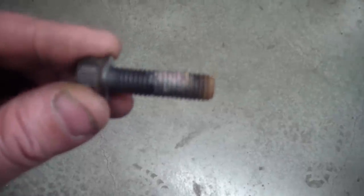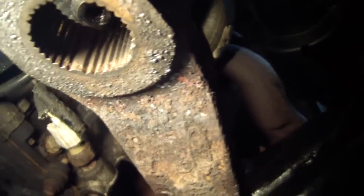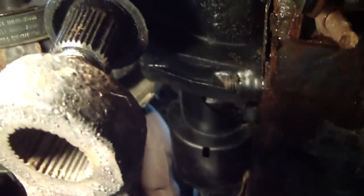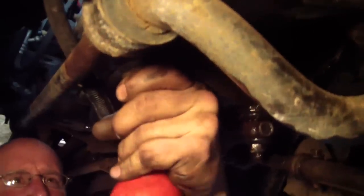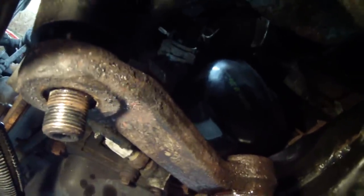Here's the bolt that holds the rag joint. We're going to add some more Loctite to that — you can see it was Loctited. We're cleaning up the pitman arm. You can see it's got these splines and it has four bigger ones so it can only go on a couple ways. We're holding the steering wheel straight, and we'll slide it on like that. Now we're going to back that nut off, Loctite these threads, and send that nut back on.